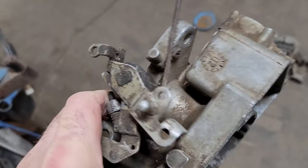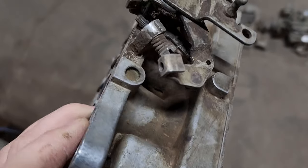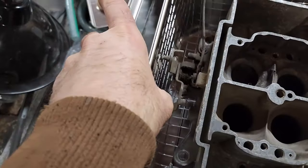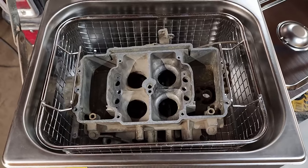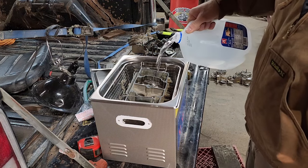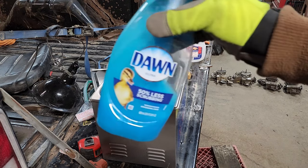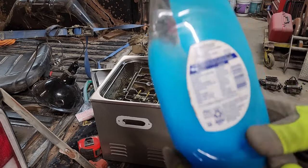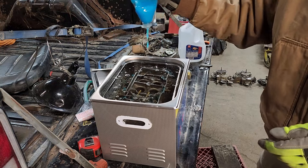Let's get some better light. It's not the worst carburetor you've ever run across. This is the one I'm going to initially try out with just water and dishwashing detergent. Had to squeeze the side of the basket out to get that to fit in there, but it is in there and the lid will close. Let's get her filled up - got two gallons of water in there, just enough to cover up the carburetor. Give her a generous shot of dish soap.